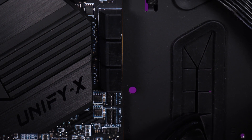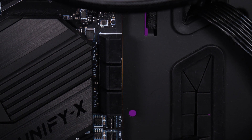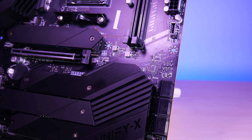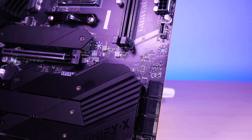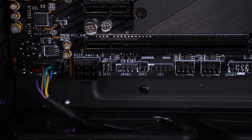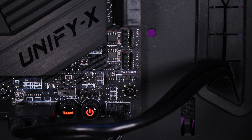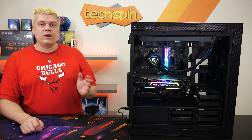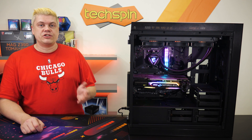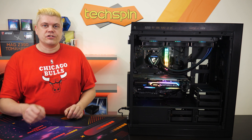Internally, the board has 6 SATA 3 ports, a 10G USB Type-C, 2 Gen 1 Type-A ports at 5G speed, and 4 USB 2.0 ports. It does support AMD Crossfire. While there are no onboard RGB LEDs, MSI has included 1 RGB 12V and 2 ARGB 5V headers along with a Corsair connector. In the box you'll get a 1-to-2 RGB LED extension Y cable, a 5V ARGB extension, and a Corsair RGB extension cable.